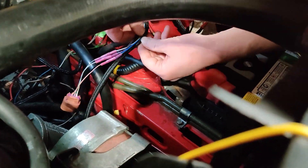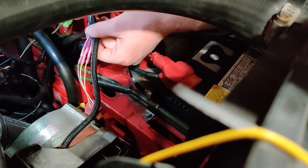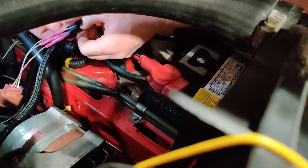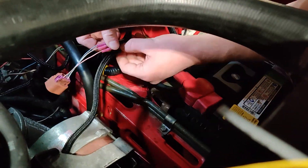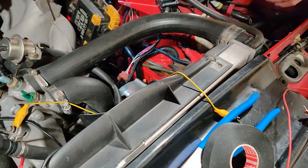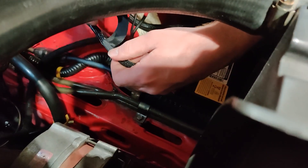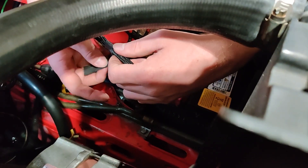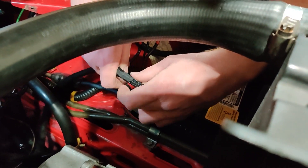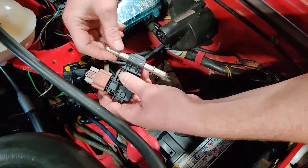I'll put a link in the description for some on Amazon or eBay. You simply open the split part of the loom and feed the wires inside it. Another pro tip: if you don't want all of the connectors bunched up in one area, you can stagger them — cut each wire progressively longer or shorter on each side so the butt connectors are offset. In this case it wasn't too big of a deal; the loom reaches over it and we just put a little loom tape around the ends and that bulge where the fittings were.